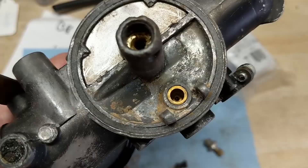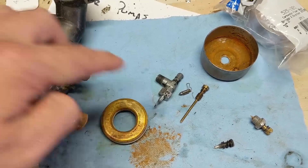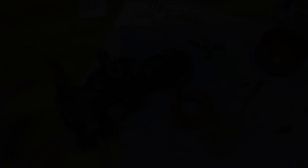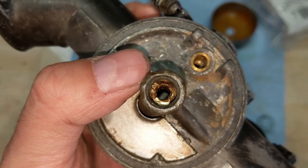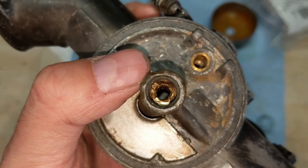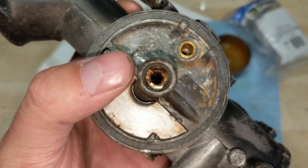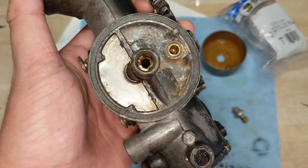The seat was completely clogged so it wasn't really letting fuel through at the fuel inlet. On this model, it just has a little fuel valve that threads into the side of the carburetor. There's all types of calcium buildup and oxidization starting there as well. Coming down to where the main jet is — that's actually the main jet inside of there. When I took off the bowl, I tried to remove the main jet but someone had already stripped the slot, so what's left of the main jet is just completely destroyed.